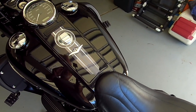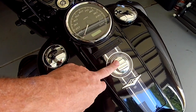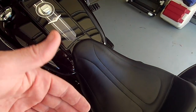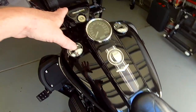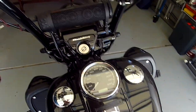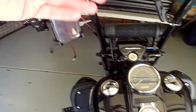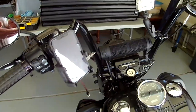The control wire has to go to something that is 12 volts constant while the bike is in accessory or ignition mode. If you do that, this speaker turns on only when the bike is on or in accessory — it doesn't turn on just by pushing the power button when the bike is off. It's wired directly to the battery, so you don't drain your battery by forgetting to turn the speaker off when you come home.